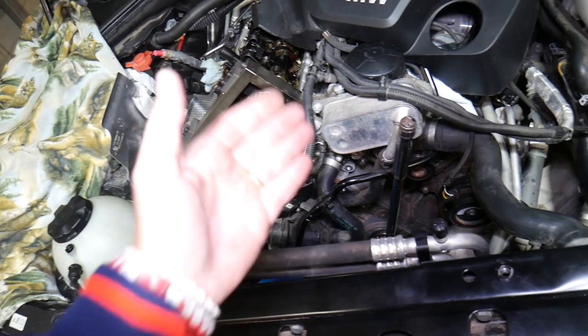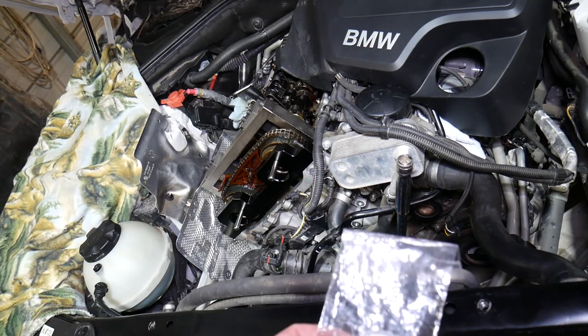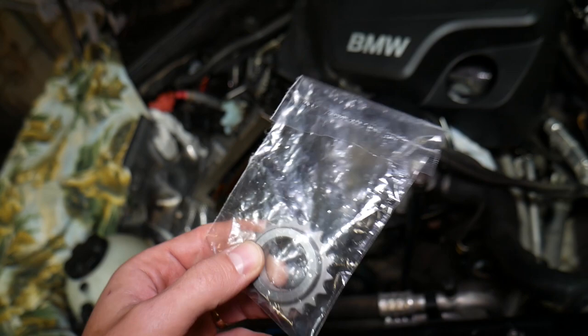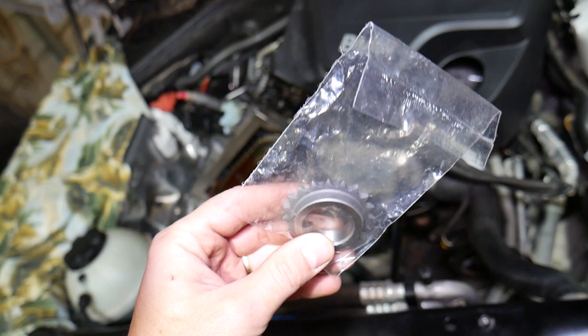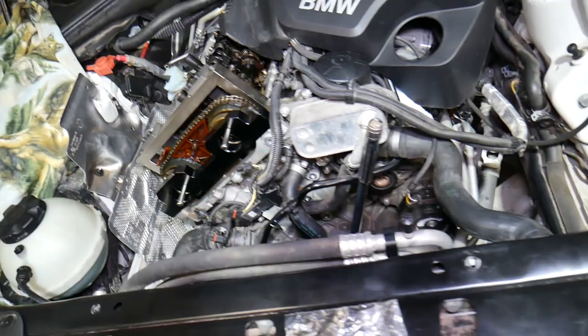You cannot just go ahead and take that bolt loose. First, you won't be able to. Second, if you get that thing loose without getting the timing correct, you will end up needing a new engine or at least a cylinder head rebuild because you will bend the valves. This is the timing chain sprocket on the crankshaft, and there is no key — as you can see. BMW uses that design so they can achieve perfect timing. Many vehicles now started using that — Mazda, Ford as well. The only thing holding the timing sprocket to make sure it doesn't slip and mess up the timing is that bolt, and it needs to be extremely tight.